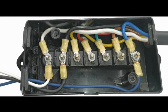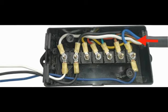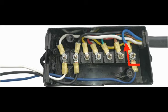The wires from the tow vehicle seven-way connector come in on the upper right side of the junction box. The blue wire is the trailer brake wire and comes from the brake controller in the truck. The black wire is the plus 12 volt charge line and the white wire is the ground wire from the truck. Follow these three wires as they exit the junction box on the lower left corner. The black wire should go to the positive terminal on the trailer battery, the white wire should go to the negative terminal on the trailer battery, and the blue wire should go to the trailer brakes. Keep in mind that some trailers may not use these same color wires. All wires should be a minimum 14 gauge in size.